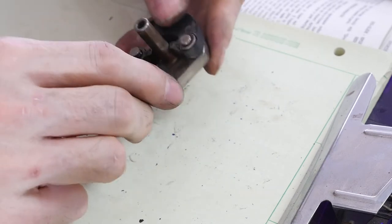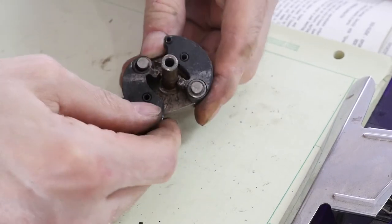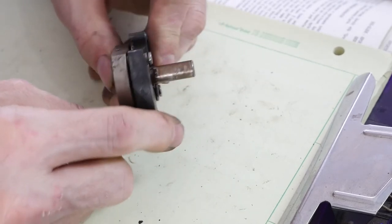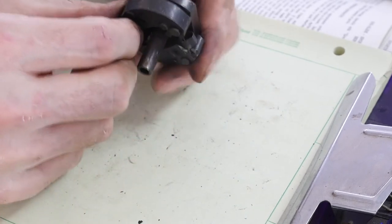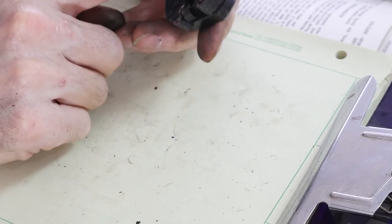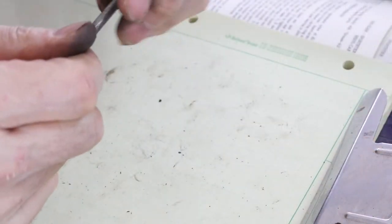Here's one that's meant to be better — it's improved. They put these little flat washers here thinking that's how they'll fix this problem. Look at this one — it's all over the place. Because that's the deal: when they fly out, they fly up and out. And when that happens, these weights — see this damage here? That's because it's been hitting the back of the plate. Here's full failure mode — it goes out and then cocks, because it's being stopped at the bottom, it's not in line. The tips of these start wanging into the back of the plate. And eventually that snaps off the quarter-28, 9/16 head bolt.